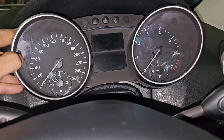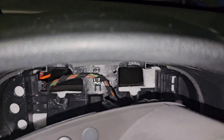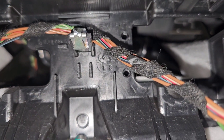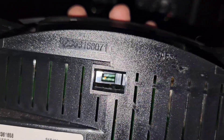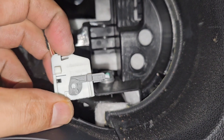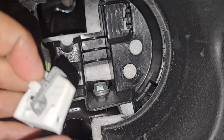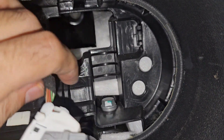I've done that because it's not possible with one hand. As you can see, there is a metal tab over here with two springs — that's the metal tab in the middle I mentioned. It won't come out until you really force it, but it won't break, don't worry. You can see the hole that metal tab goes into, right in the middle. To remove the connector, push the tab and release it — just like any other Mercedes-Benz connector.